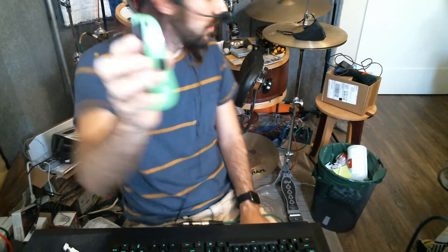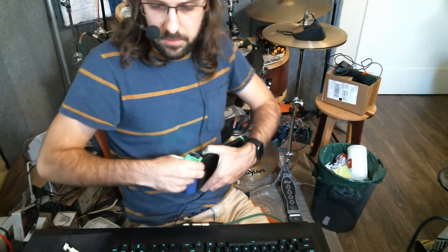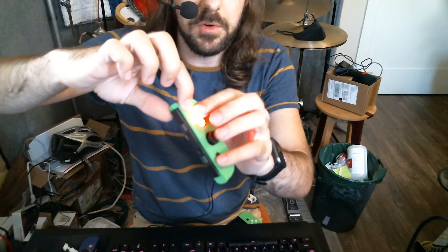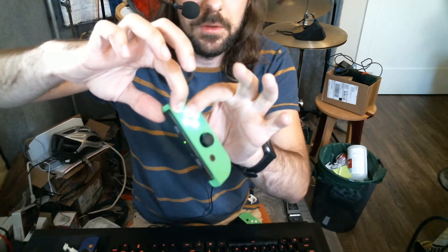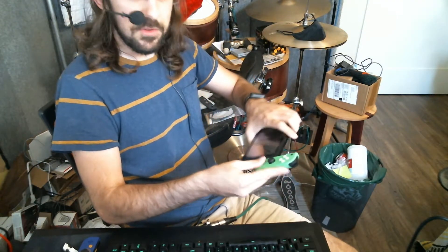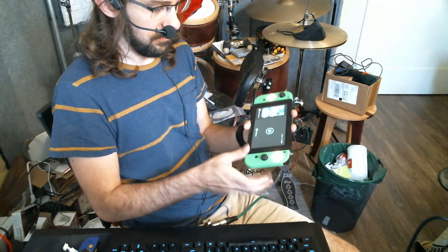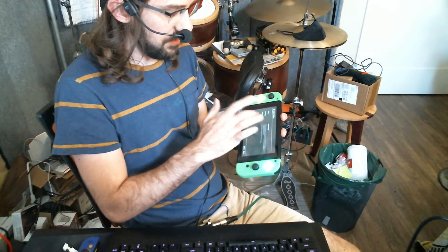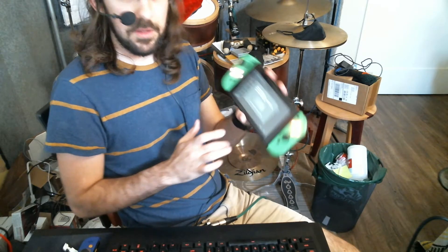There you go. The top one I left. Let's go ahead and try that. This is the point where you're going to want to test functionality. I got it all together and everything seems to be working fine. The first thing you're going to want to do is shut off display mode: hold your primary button and press the secondary one four times and hold — it'll flash green and then turn off. When you plug it into the Switch it'll light up. Make sure to run any controller updates that are available. It's updating now.